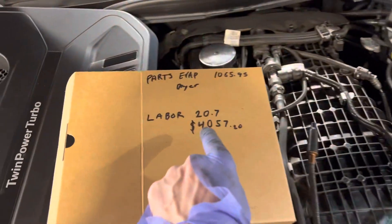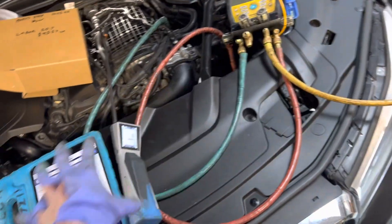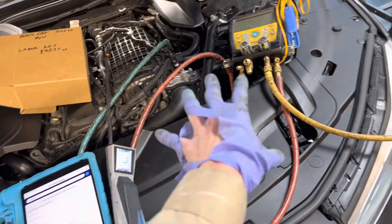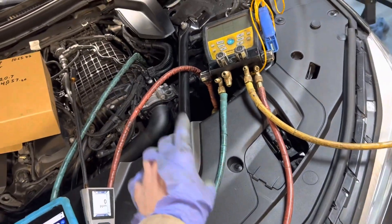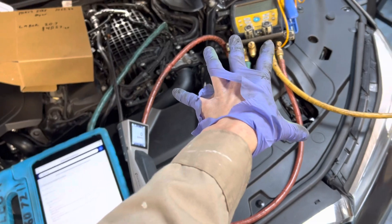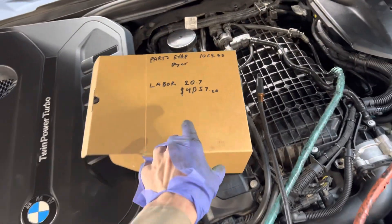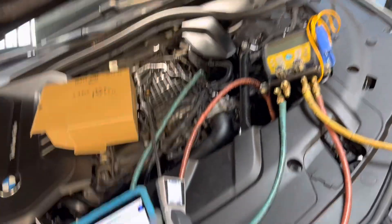So that's another $500 on top, plus labor. You're also going to be draining and purging the glycol system because liquid glycol coolant goes into the plate heat exchanger — that procedure plus materials adds up. With labor and everything, you're probably looking at another $800 right there. On top of the $4,000, on top of the $1,000, add nearly $200 for my diagnosis to find the leak, then the recharge — it's YF refrigerant — almost another $500. So we're approaching north of $6,000 for a leaky evaporator.